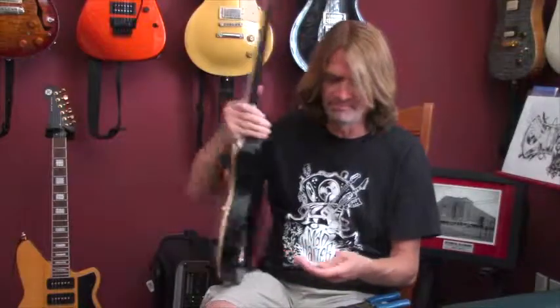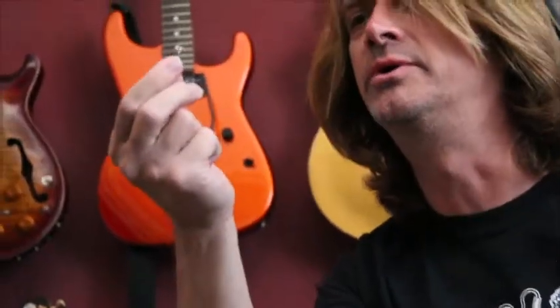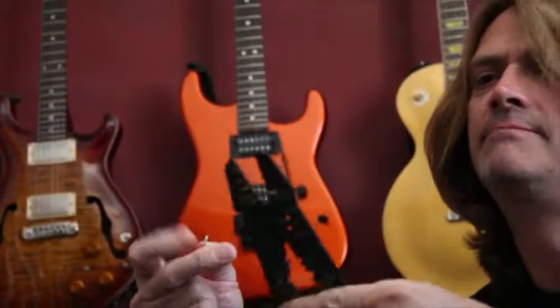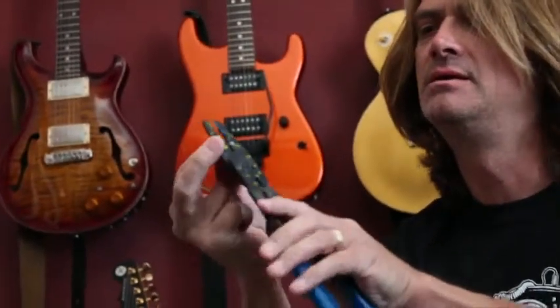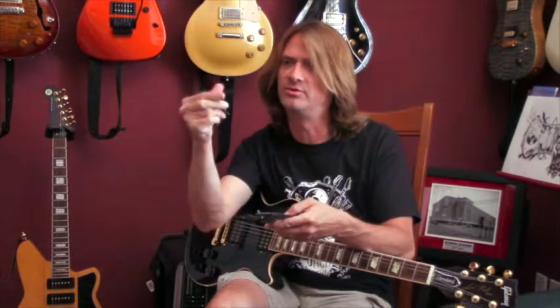What we recommend is taking a little piece of wire and some type of crimp terminal. Here I have a ring terminal and just some crimp pliers — just some cheap ones you get at the store. Put the wire in there with the heavy one, just crimp it together and that's all you need. Then you've got this little extra wire to go to the dual volume board.